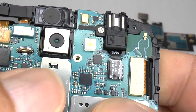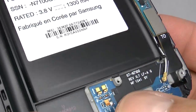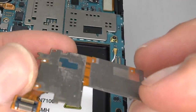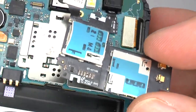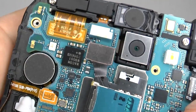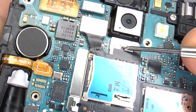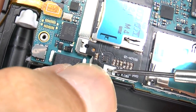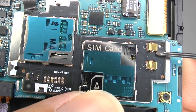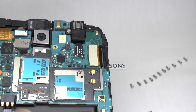Final check to make sure that all the cables are connected. Now we can replace the SIM and SD tray. If you have a new one, you'll have to remove the protective coating to expose the double sided tape. Start by plugging the ribbon connector in, and then make sure these white parts line up with the raised pins on the main board. Once you're happy they're lined up, just gently push the SIM tray down into place.